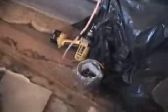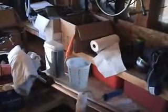Big old gap there. I'm going to do a little bit more sanding and cleaning, but that's the backboard that's out there. And when I put the new transom in, I'm just going to smear epoxy all over this area, and smear epoxy all over here. Get it all real wet and gooey, and as quickly as I can, put the transom up against there and screw it in, and just hope for the best. But I have my drill and screws. I have my little grinder right there, so I can do my cleaning. I have my little stir sticks and acetone and a rag, and I have a quart of epoxy hardener, roller, cup, extra roller. I've got everything I need.